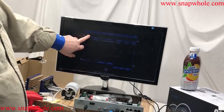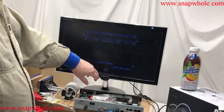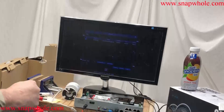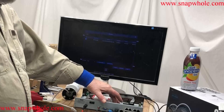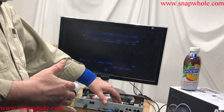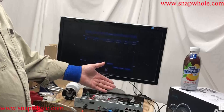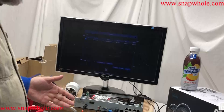If I go here and check this hard drive, then do 'format hard drive,' that will format it and get it ready for use. My concern was whether this is a 32-bit Linux system, because a 32-bit system would only see two terabytes. Since it's seeing over two terabytes, it must be a 64-bit system. So if I put a 16 terabyte drive in here it should read it — we have them, but I'm not going to pull them from service just to test here.